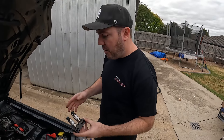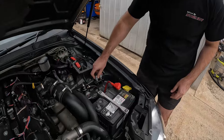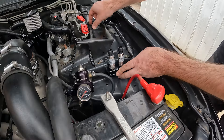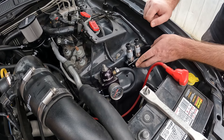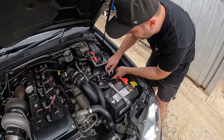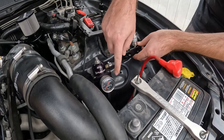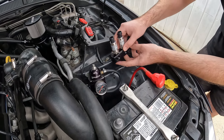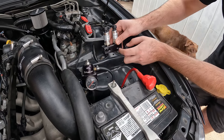You may not follow the same route as us, but this is what we're doing. We'll mount the sensor block somewhere there, and with the auxiliary connector there, we'll run sensor wiring over to it. That way we can put some gauges on them if you want, so you can measure them both through the Haltech and mechanically. We'll take this gauge off, run a line to here, with lines coming from underneath, and then block these off.